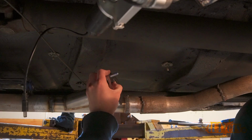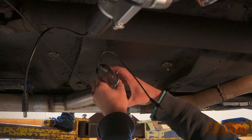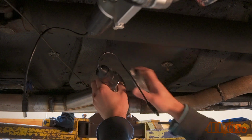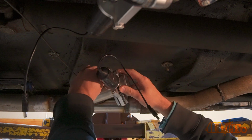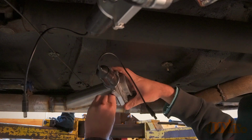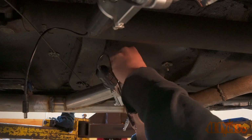Do the same for the opposite side. Install that flat washer and lock washer onto the bolts and apply some thread locker. Install the gasket, butterfly flap, gasket again, and then the flange. Finally, the band clamp and turn down is installed and tightened in place.